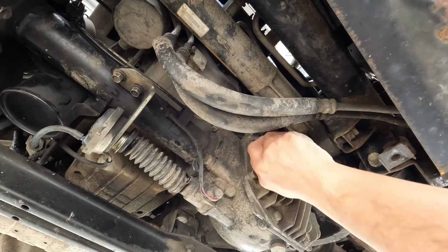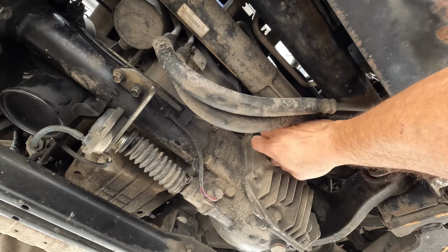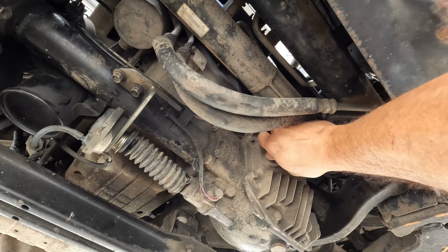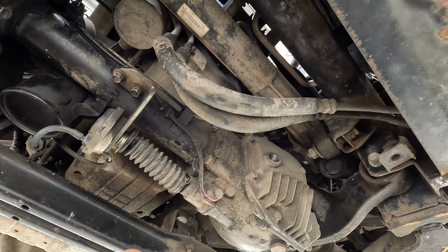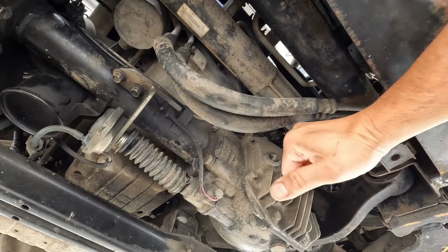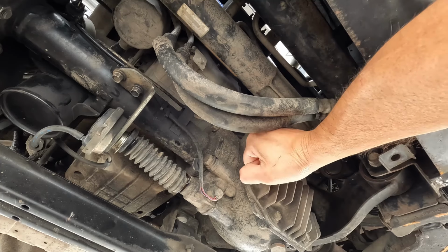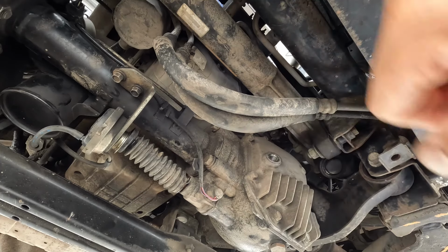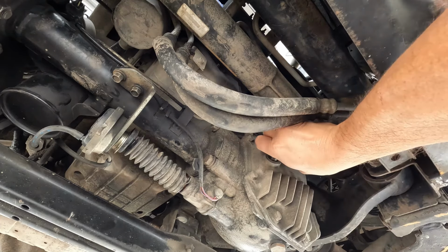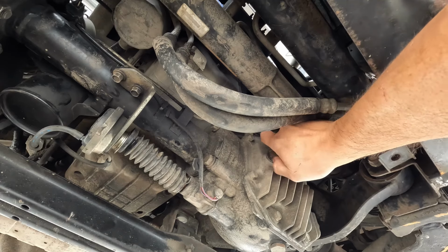Okay, so let's take it off. Damn it. Tight, it's tight. I'll tell you that right now. There. See? No water. And the fluid should be right at the level here. So we got some fluid in there. Can't put my pinky all the way in there, but it's definitely fluid. There's no water in there. So that's one thing to check after you drive over water.